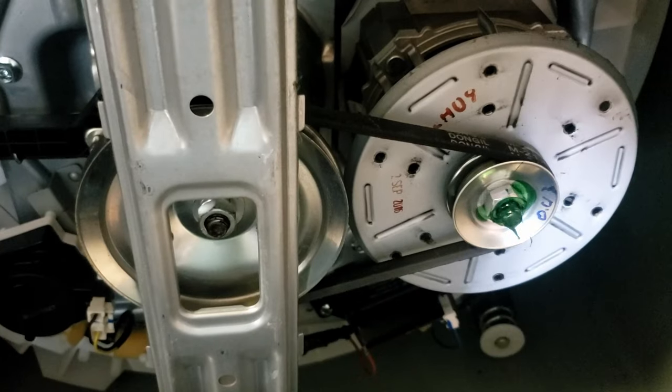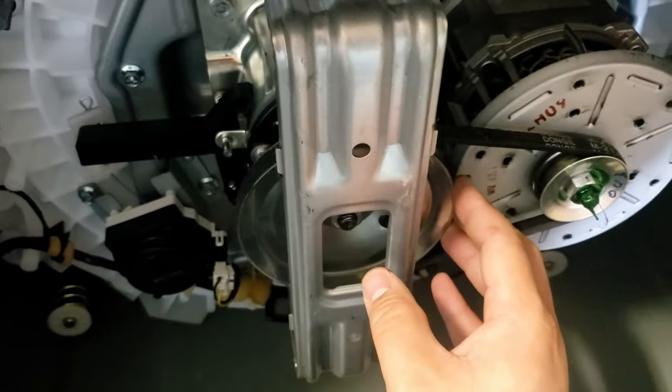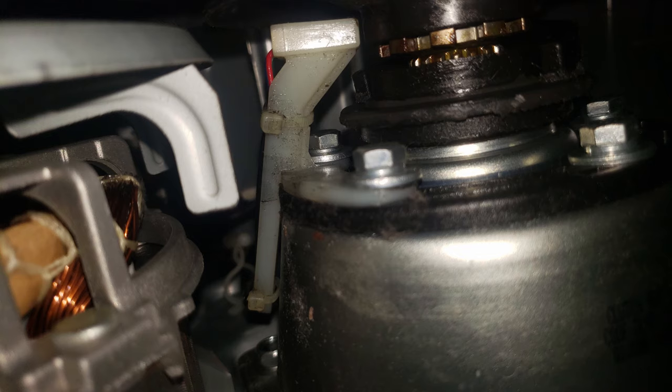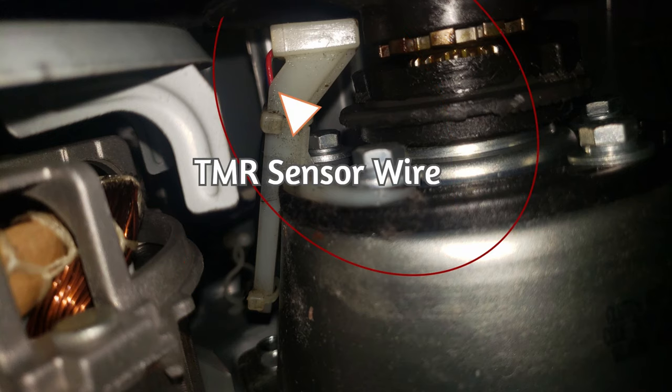The issue is very elusive and small. If you look at the unit, up on top is your TMR sensor. This plastic shaft is a pain to get undone, but this is where our problem was. You need to remove the large bracket and other components involved with the motor and transmission to get to that TMR sensor. The TMR sensor is in a difficult spot to videotape, so I had to resort to photos. The TMR sensor is the white piece that is circled — a wire harness goes to the sensor, which calculates the run speed of the motor. In our case, a wire had been snapped to the sensor, causing it not to work.